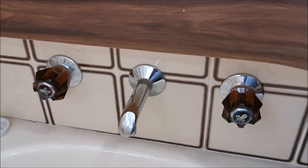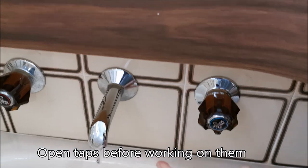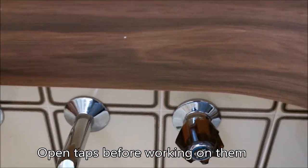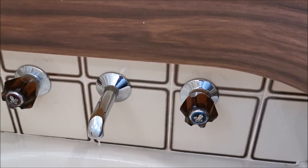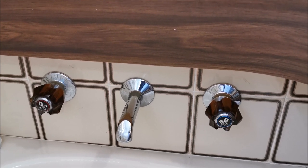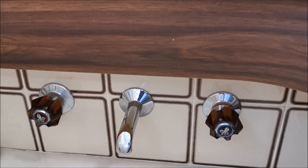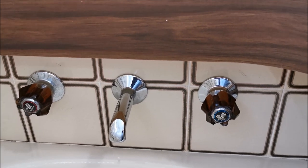Back in the bathroom now. It's an idea to open both taps to let the water drain out. Not only that, it takes the old washer off the seat of the tap, so when you're undoing the taps you don't have the pressure of the washer against the seat - that makes it easier and you have to use less pressure.